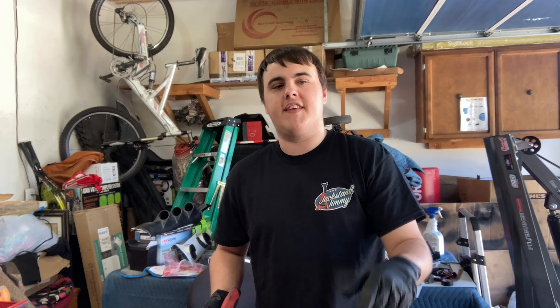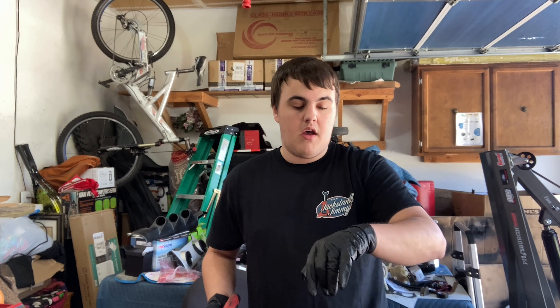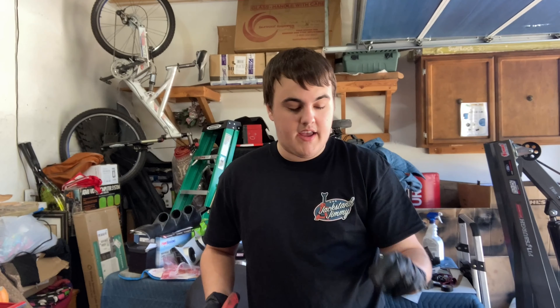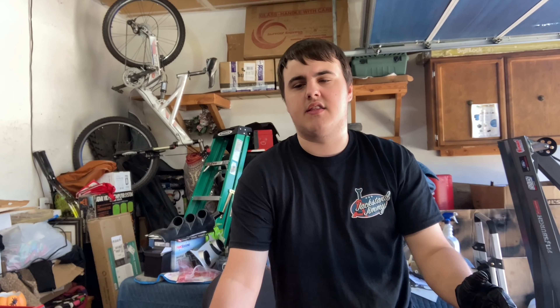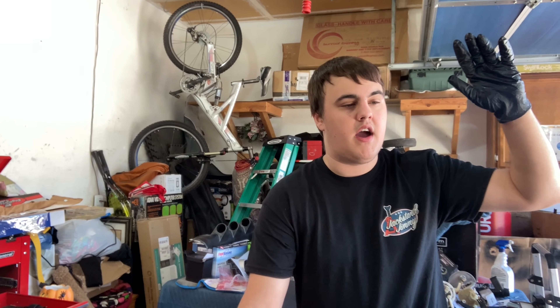Well, that's great - on this fresh motor, that's not good. Like 166,000-mile motor, didn't break into it at all. So what we did is I drained and refilled the oil with brand new stuff, and then we did that again when I brought it back over to Davis's. Essentially three oil changes in basically the first week of it running. And then immediately thereafter, I cleaned the coolant system and we could see oil coming up out of the radiator.